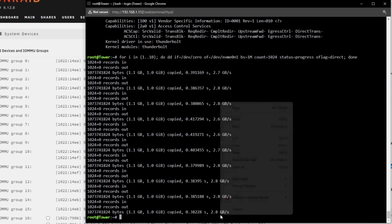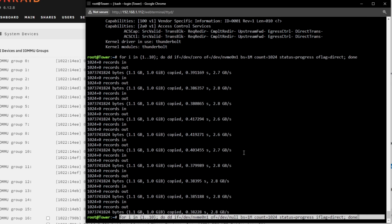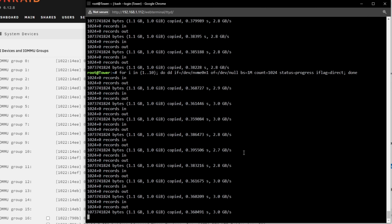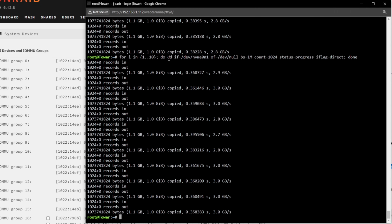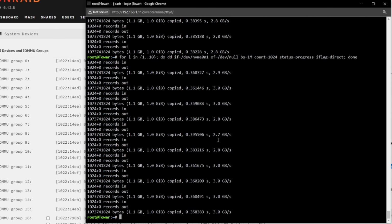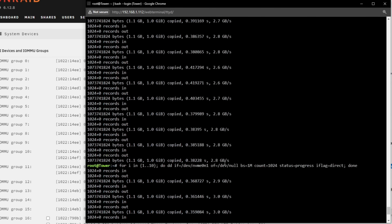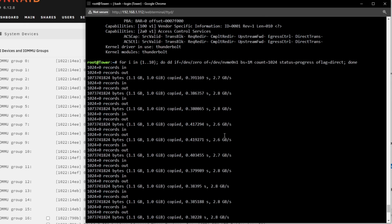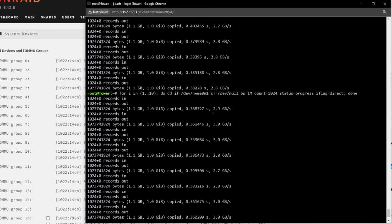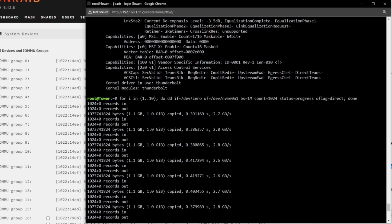And moving forward onto some read testing there, let's copy in the same code there. We're able to see that in terms of read testing, we're obviously going to see a slightly increased number. And again, we are using a cache-less test, but that's still pretty good numbers for a Gen 4x2 drive, cracking that 3 gigabytes per second consistently in read, and in write hitting highs of 2.8, so 2,800 megabytes per second. Again, we'll work out the mathematics of 1,000 versus 1,024, but still nonetheless, this is still telling me some great numbers for the PCIe and M.2 layout here so far. But that's really about it.